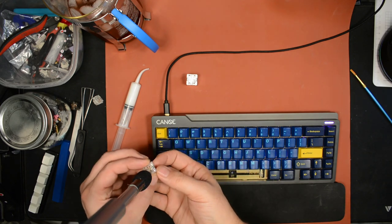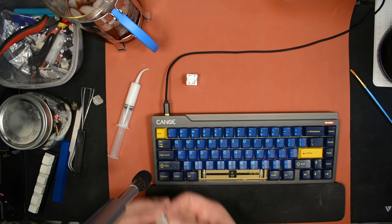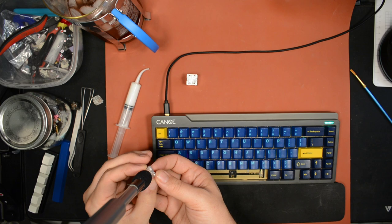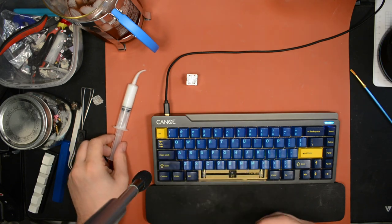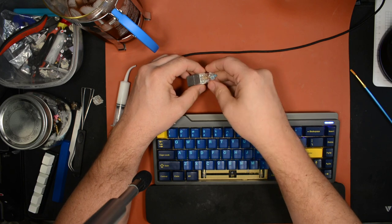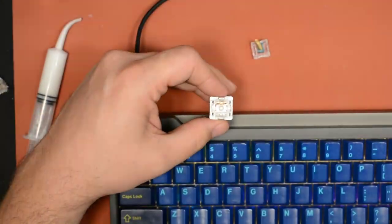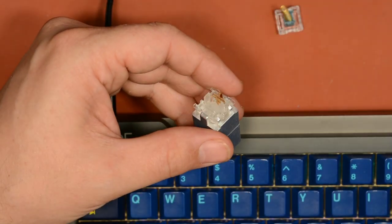But you might notice the tiniest bit of ringing left. Yeah, at bottom out. Okay, notice at bottom out. Hopefully you heard it. The interesting thing about that little noise is I don't think it's coming from the spring, because I greased that thing up pretty good and I don't think it's ringing. In my experience, some of that noise is coming from something else. I think it's actually coming from the leaf. I think the leaf can ring as well at bottom out.